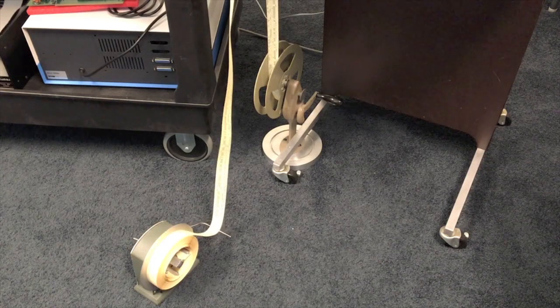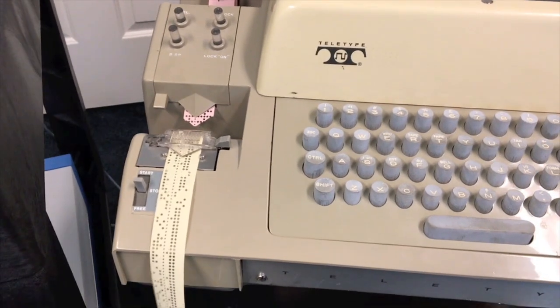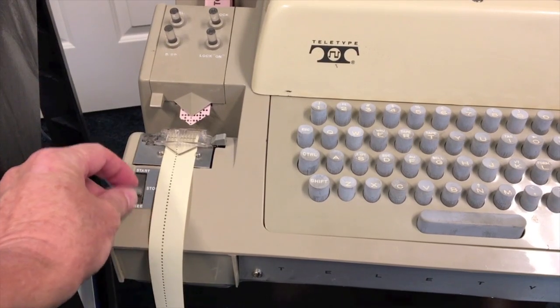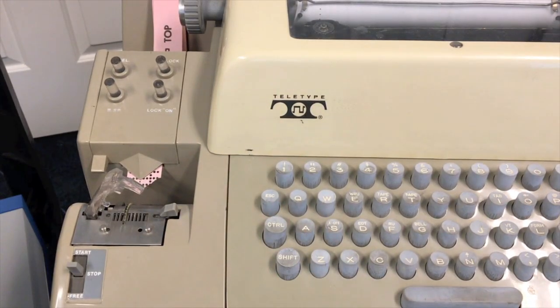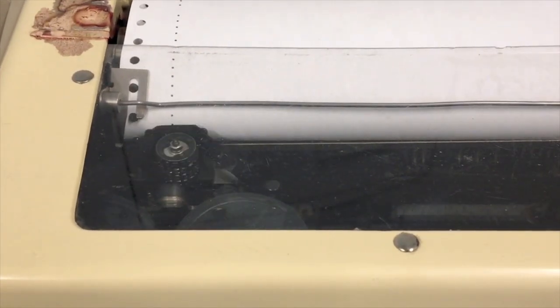Here comes the tail end of the tape. When it finishes, hopefully we'll see it turn echo back on and part of an S record. Those are the nulls at the end of the tape that it's complaining about. Cross our fingers here — I'll jump to zero, which is where basic starts.